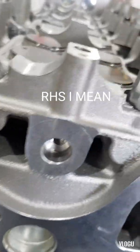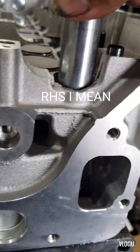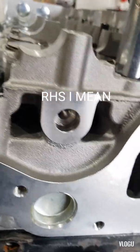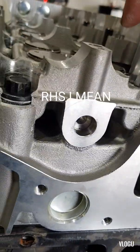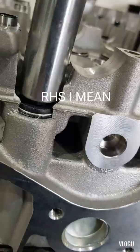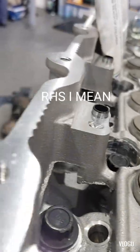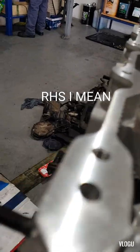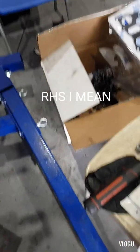This is especially important for head bolts that don't have a separate washer — where the washer is integrated with the head bolt. That's really dangerous when you tighten the bolt because it creeps and damages the surface of the head where the bolts are seated. So that's a small tip I have to show you guys today. The sequence for the head bolt tightening is shown here.